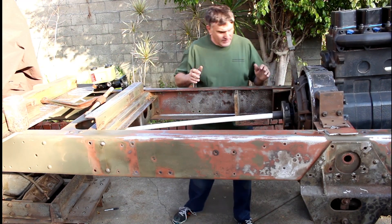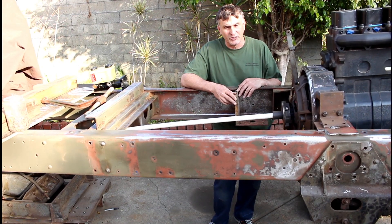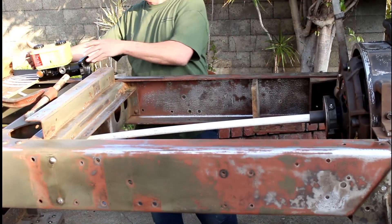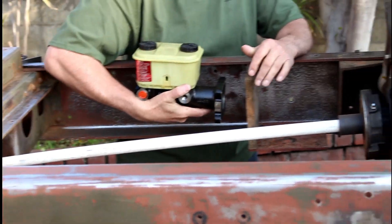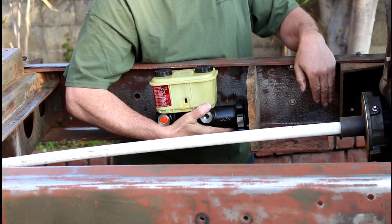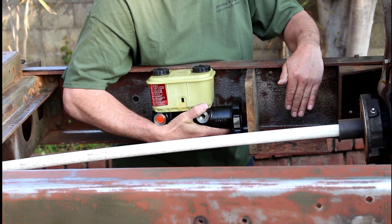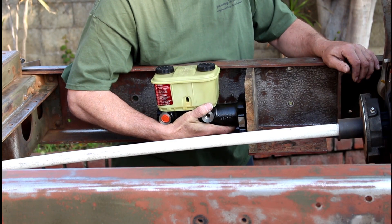It's really nice when you have some remodeling being done because you're left with a whole bunch of wood that's easy to chop up and use to visualize things. As you can see, I've got this eight-inch piece of wood and that's what it's going to take to mount this HydroMax master cylinder and the booster — it's going to take every bit of this. So I'm going to have to use the offset clevis and possibly move where the arm is to make the rod attach to it.